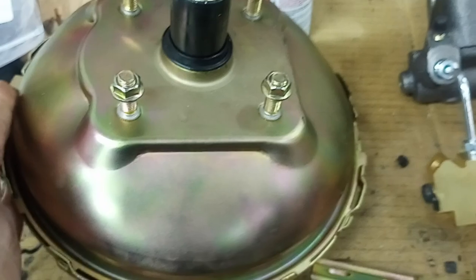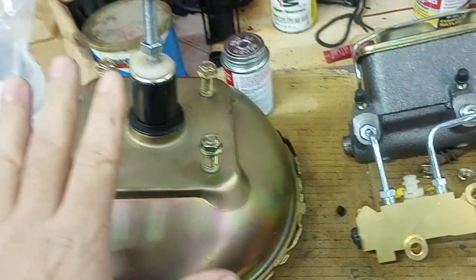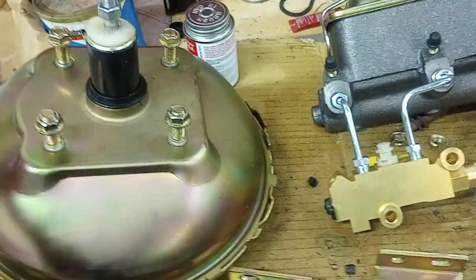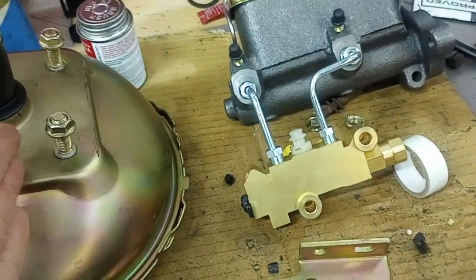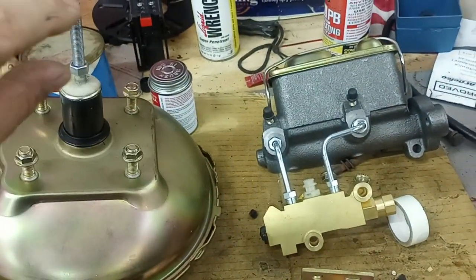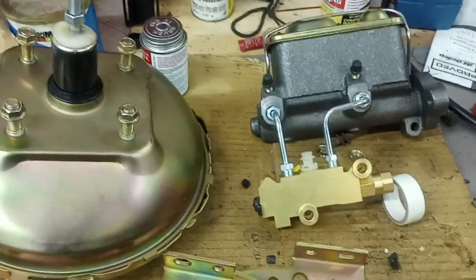And this is a bigger booster too — it's an 11-inch booster compared to the nine-inch. It does fit and it does stick out a little further, because obviously you've got the bracket that bumps it out. And then the master cylinder is a little longer, so it does run into the power steering hose, which isn't too big of a deal. There's a metal connector piece before the rubber and you can just bend it down a little to get it out of the way. But yeah, more to come when that's in. Thanks everyone.